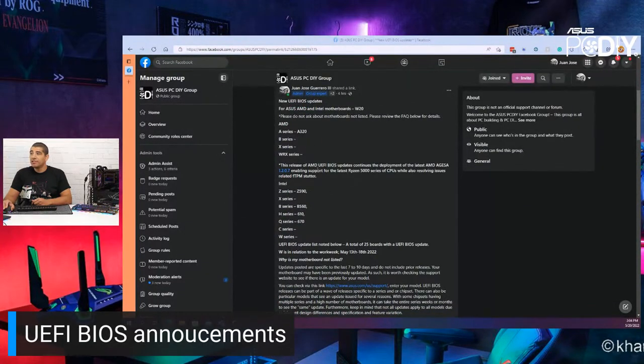It's predominantly a continuation of our UEFI releases that incorporated the AMD AGESA 1.2.0.7 release, which is focused on users who wanted support for the latest generation of AMD CPUs, like the 5800X3D, as well as the large number of other CPUs AMD has released in this recent refresh. For those experiencing fTPM stutter, this AGESA helps to resolve that. There are also some miscellaneous updates for users on the Intel side of the fence for Z590, B560, H610, and Q670.